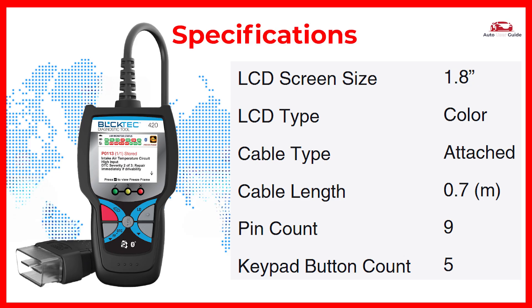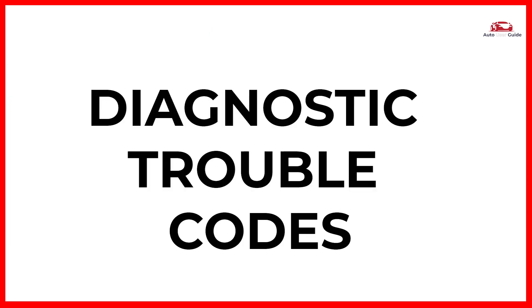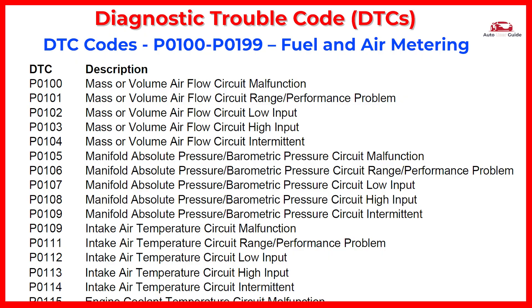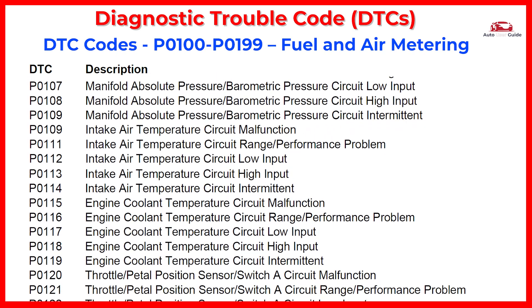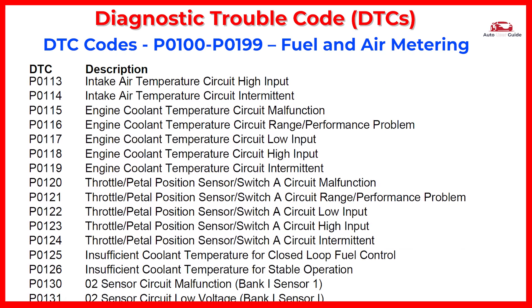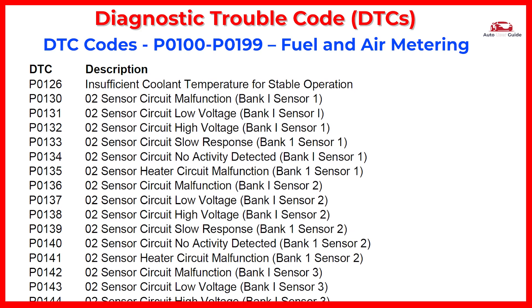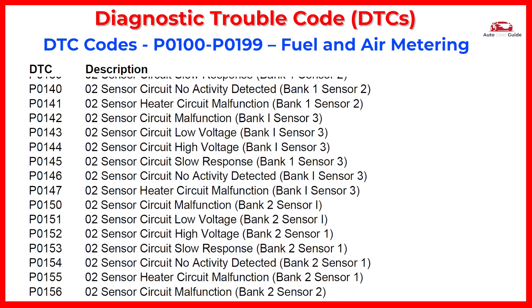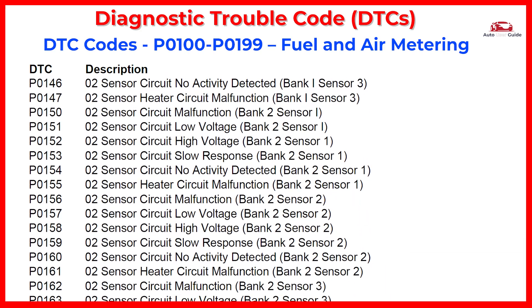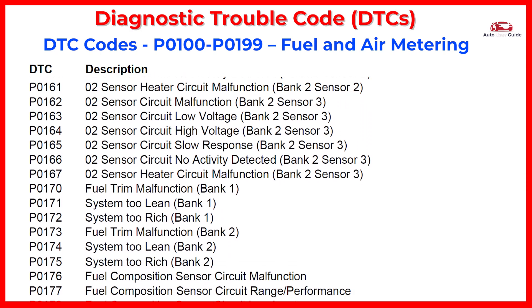Specifications are also provided. The tool includes a list of Onboard Diagnostic Trouble Codes — DTCs — which are standard codes used by manufacturers to identify vehicle problems. Diagnostic trouble codes are how OBD2 identifies and communicates to technicians where and what onboard problems exist. The first number in the DTC indicates whether the code is an SAE generic code applying to all OBD2 systems or is specific to the vehicle manufacturer. The remaining three numbers provide information regarding the specific vehicle system and circuit.